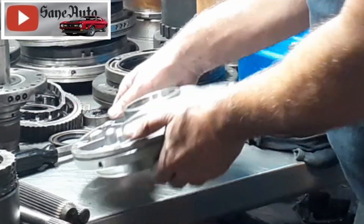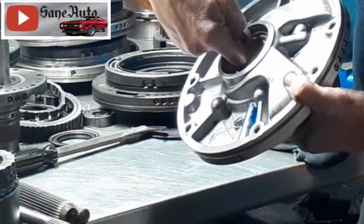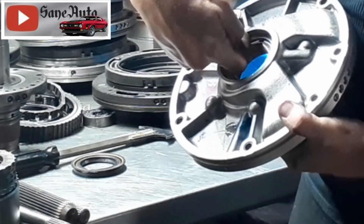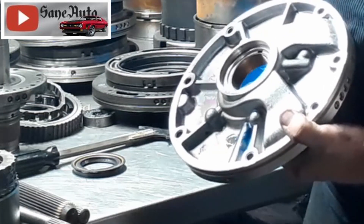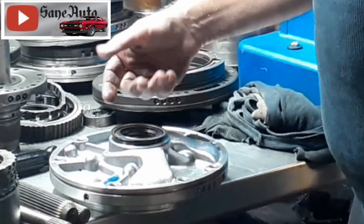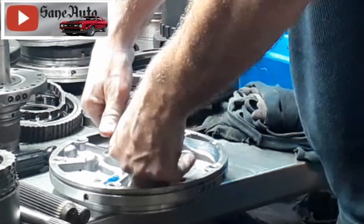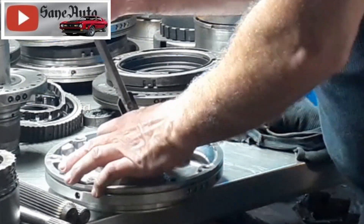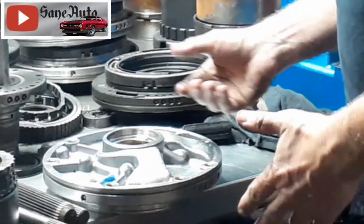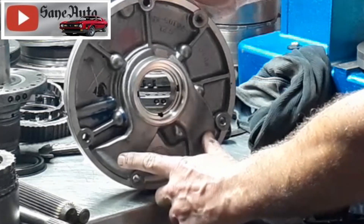Take a look at what's unique about this 4R70W pump seal — it has a rubber lip sticking out the bottom. Ford has cut in here so there's a lip facing inward, so that when the seal tries to come up, this rubber catches on the inside and prevents it from pulling out. This enables you to more easily pull it out with concentrated force on one spot, but it's almost impossible for fluid pressure to pop it out. You can even put these seals in with thumb pressure.